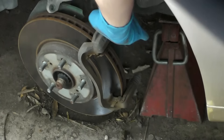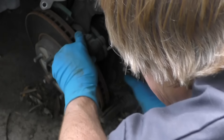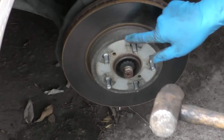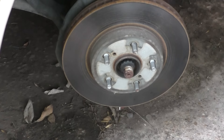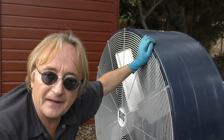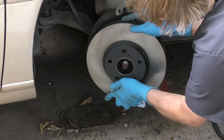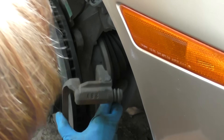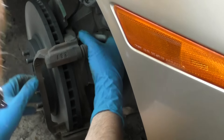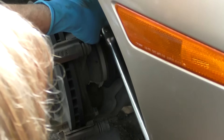This caliper is only $19 and you can use it forever. Now to get the rotor off, we have to take the whole brake caliper assembly off. Get a giant bar, stick it on, then pull like mad until it comes loose. Turn the wheel so you can access it better, finish taking the bolt off on the bottom, and off it comes. The old rotors often stick on, so whack it from the back side to get it off. New rotors are often coated with rust-prevention coating, so get a can of spray brake cleaner and turn on a big fan because this stuff stinks. Put the new rotor on, line it up, then get the caliper bracket, line it up, put the two big bolts in — one on top and one on the bottom — wiggle them until they go in the hole right, and make sure those bolts are on nice and tight.